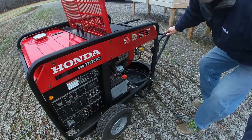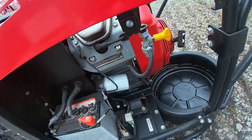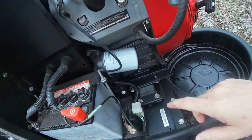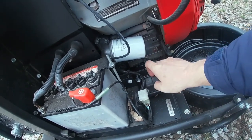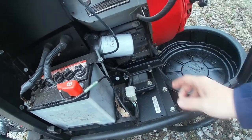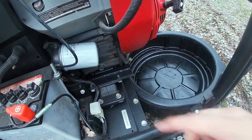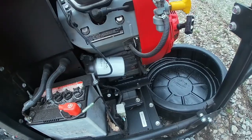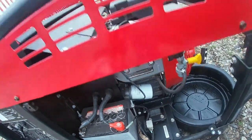This is your oil filter and this is the main drain for the engine. It actually falls into this little tray and goes out, so you can position your oil drain container here and the oil will just flow right in. The next thing to do is drain the main oil.